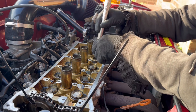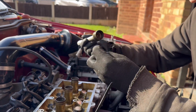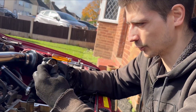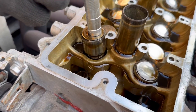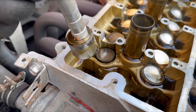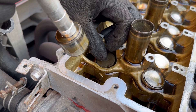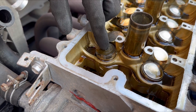These cams are so aggressive that what we're going to do is space out the inside with these shims — just little spacers. What it does is the rockers inside the valves are just going to push up that bit higher, and that way the cams can be ground down even smaller. This just makes the lift even higher because it's spaced out. Because it's so oily I think we should have dipped these a bit — but then again it's going to move underneath and just get oil in it anyway, so it's not a bad idea to preemptively lube them as you put them in. Yeah, that's an aggressive lift.